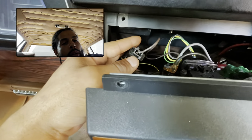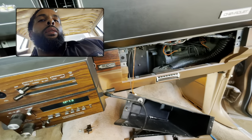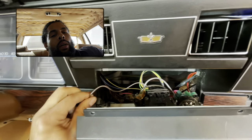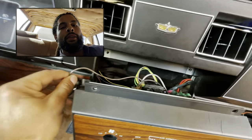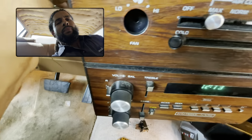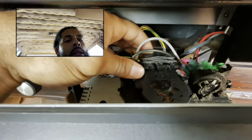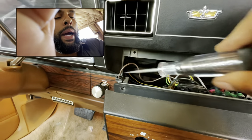It was a shortage right here — look, the stuff kicked right on. As I'm riding and I hit a bump it was going off — that's the bump. I would hit a bump. I turn and it comes back on. I was doing my blower motor switch thinking it was the switch, but it's that wire. It runs to this. I had to test with my test light and it wasn't getting power until I moved that wire, and then it got power, and now everything is on.